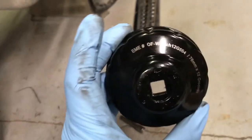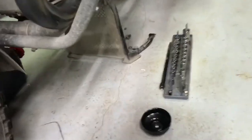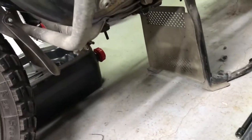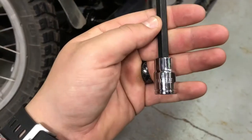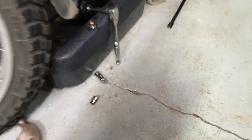To get the filter out you're gonna need this little tool here. Give it a little tap to help it out — there's the filter. It's recessed up in the engine; I think it's kind of a dumb setup but whatever. I also almost forgot to mention you're gonna need a nice 8mm to get the drain plug out.